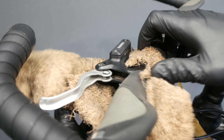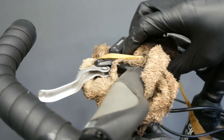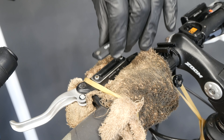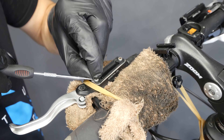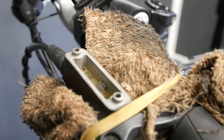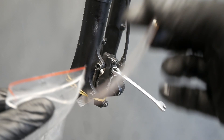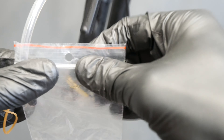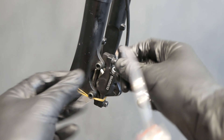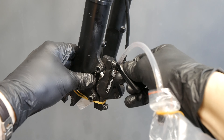It's also a good idea to have some cloth around the braking lever so that you don't have to do much cleaning afterwards, because when you remove the cover some oil might come off, and at the end you're going to lose some oil. There's almost no oil inside, so we need to fill that in. Mineral oil — that's the advantage of Shimano brakes — it's not that dangerous for your fingers, for your floor, or for any other parts of the bike. You only need a tube, which you can maybe find in your house, and just a little bag.